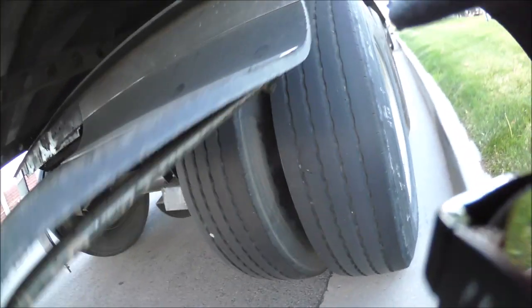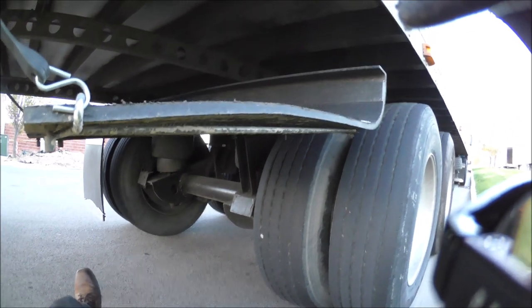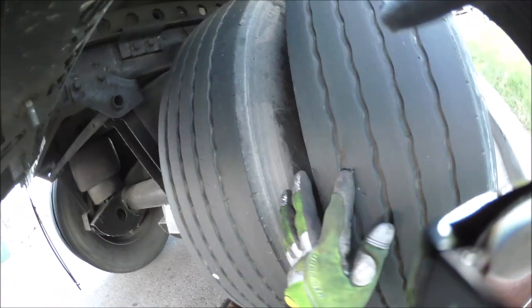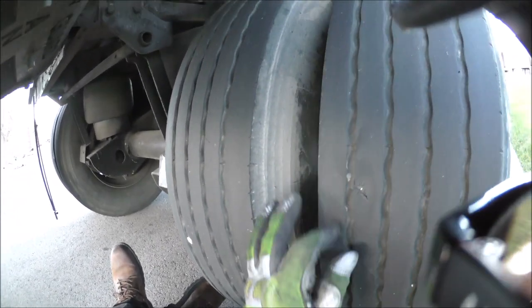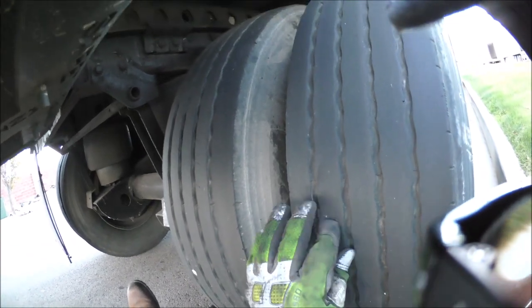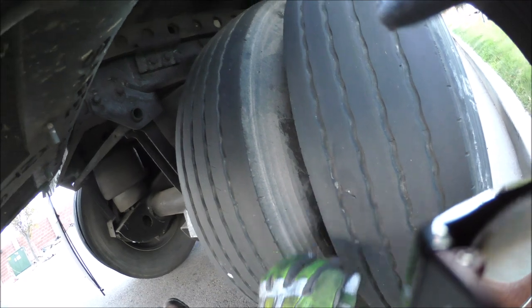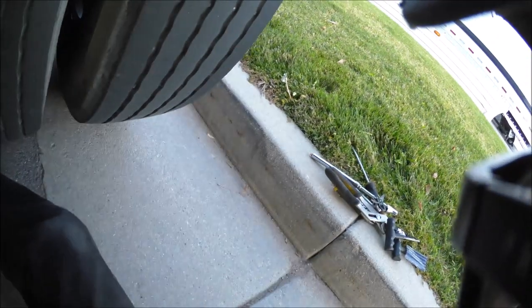Let's see what we got here. The last plug I put on here - that's on the head cam playlist - is from this tire, and it's right in front of us. This is what the plug looks like when I put it in there. This is about six plugs in here. I pulled a big bolt out. Looks like I have this one here I've got to take out - I can pretty well hear it hissing.